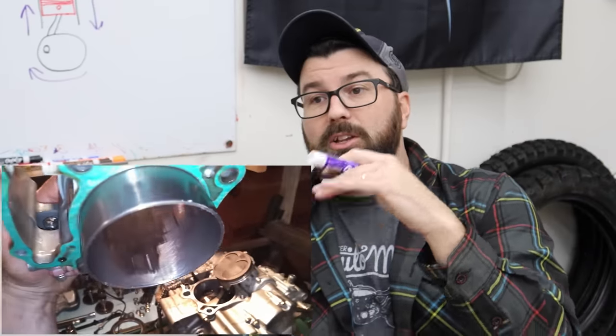This is one of the reasons we're only going up to a 301. There are other pistons that can take it up to a 320-something or almost a 350. When Ari first told me the kit takes it up to 301, I immediately asked about going bigger — like a 325. He quickly told me no: if you want to keep it reliable, don't go any bigger than that. In this engine, with rod length, skirt size, and other factors, you can only manipulate a few of those numbers in a factory engine. If we go larger, it will wear itself out. I found videos and Reddit posts where people with the old 250L went to those bigger pistons — the engine got eaten up in almost no time. Remember, this is a guy who races these things, had them at redline all day. He says 301 is the limit. It's a 286 stock, so it's a bigger bump than it sounds.